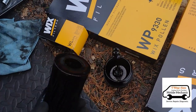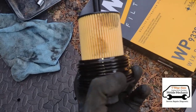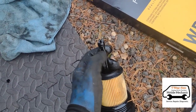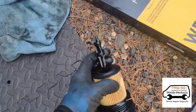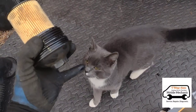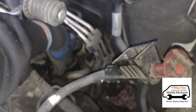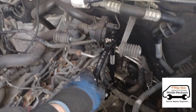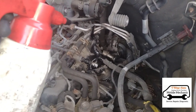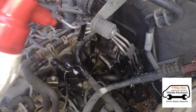Pull the old filter element right off. Slip the new one on — you should hear it click into place. There are three o-rings: one here, one here, and one here. Here are the replacement o-rings to put back on. We've slipped the oil filter back down where it came from and tighten it back up. The filter is back in place — just spray a bit of brake cleaner down around where it was to clean off any little drips. That should be fine.